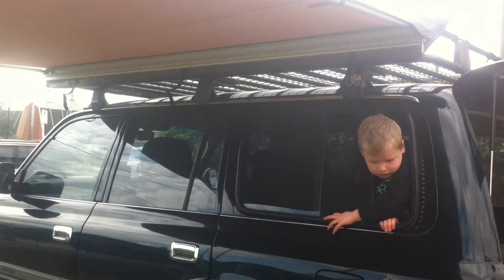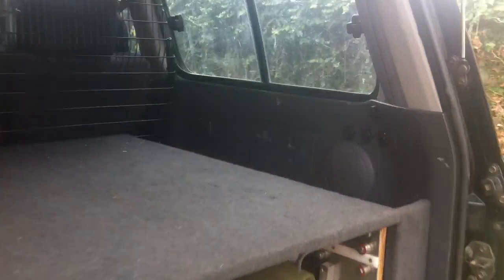So first of all, what I've got is a little fuse box just down in a compartment on the side. That's where I've got my power from. That obviously connects to my main battery under the bonnet. If you've done it properly, you might have an auxiliary battery. You would actually run it from there, so that you wouldn't be draining your cranking battery.